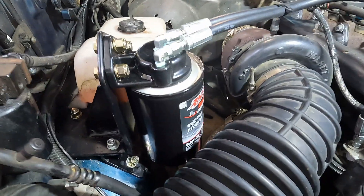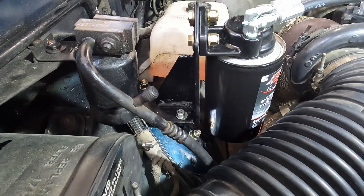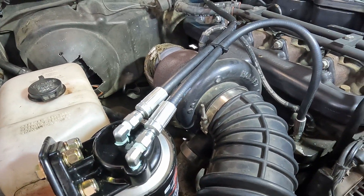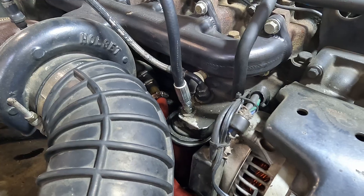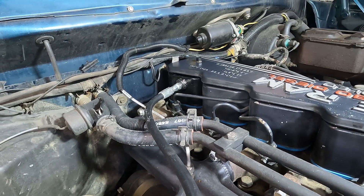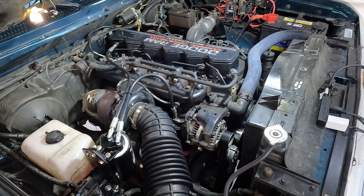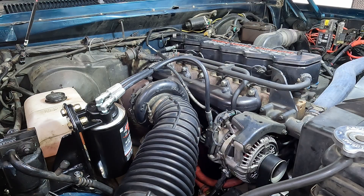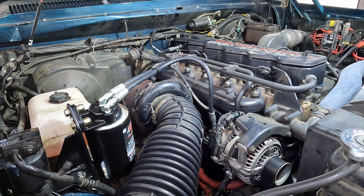Here's a shot of the final product. We've got our massive 2-micron filter mounted to the filter head and bracket installed on the wheel well on the passenger side. Here are the two lines — the oil feed line and the oil return. The feed comes out of the stock filter head with the replacement Amsoil high flow filter, and the return goes into the welded bung on the number 6 cylinder valve cover. The truck has been topped up with 5W40 Signature Series full synthetic Amsoil oil and we've got the Fumoto valve underneath for future oil changes. That sums up the installation for an Amsoil oil bypass system on a first gen Cummins. Hope this video helps — see you next time, thanks for watching!